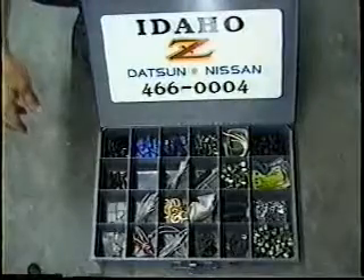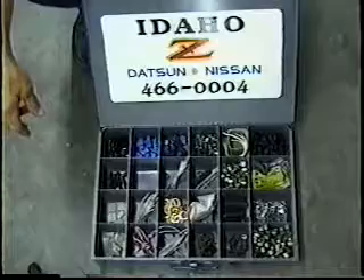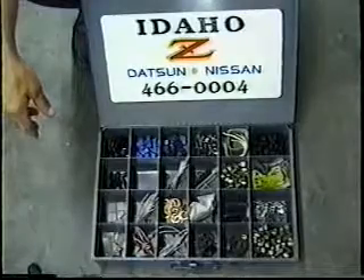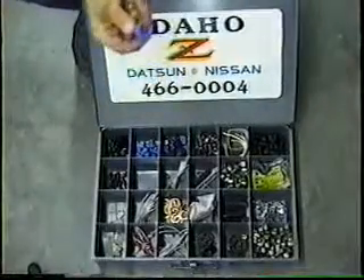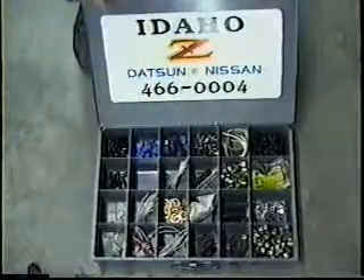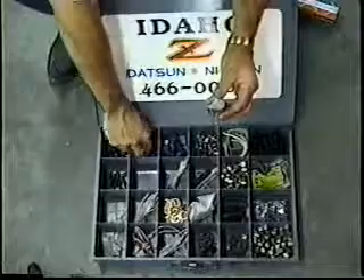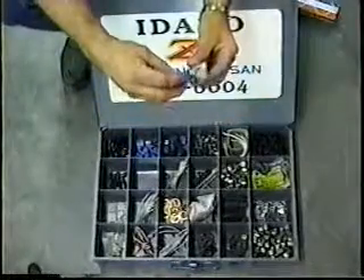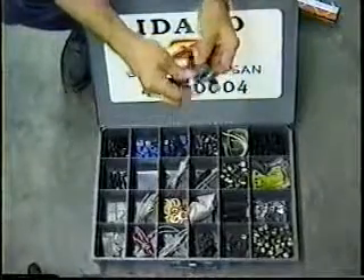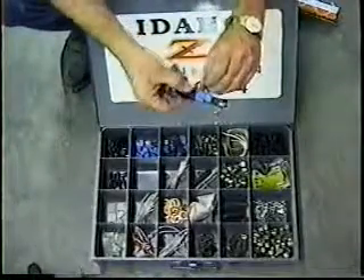For those of you who don't want to buy new injectors, there may be life left in your old injectors. Various aftermarket companies have thankfully tooled up and filled the void in some of the parts that Nissan doesn't want to sell us. One of the most notable is the connector housings that go on to the injector itself. The injector housings simply clip on, and they've got a nasty little clip that likes to lock into place. Once it's snapped on, you can't get that off without virtually breaking it, and that's usually why so many of these end up broken right where the connector goes.